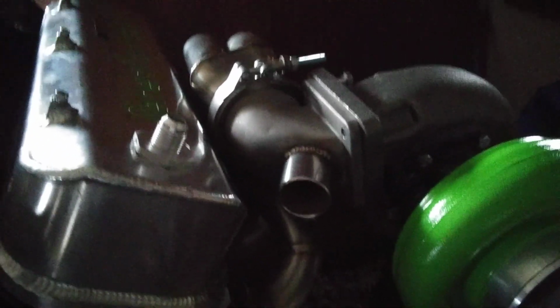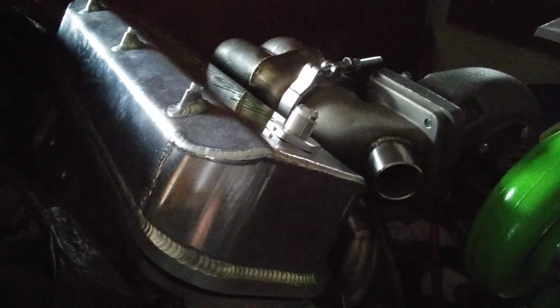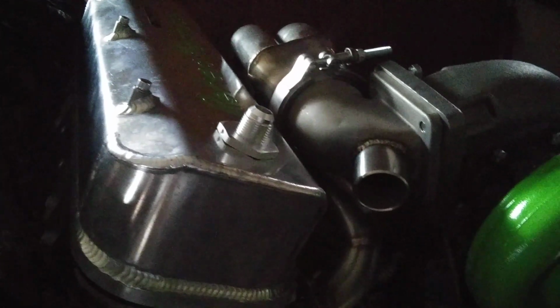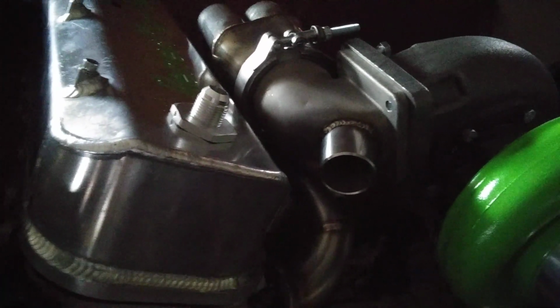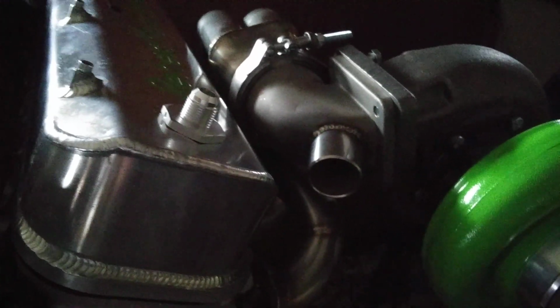We're starting to get closer. All I'm waiting on is I'm supposed to have the flex plate here today. Motor mounts will be here tomorrow. Then we have what we need to bolt the transmission to the engine and get it slung in a truck. I've already been working and got all the extra bracing put in the chassis. I looked at some aftermarket chassis that people have done, and I put my own bracing in. It's all 1/8 inch, 1 3/4 tube.